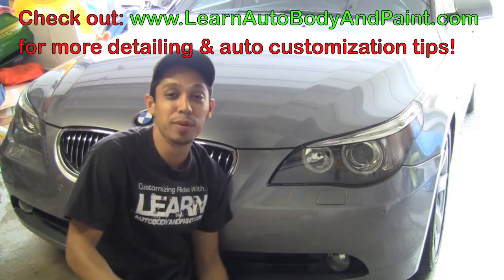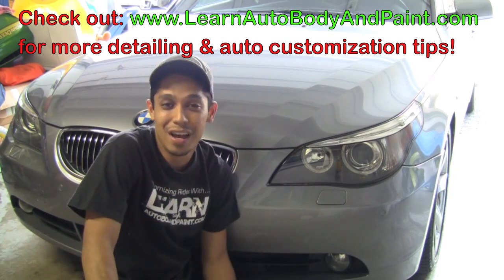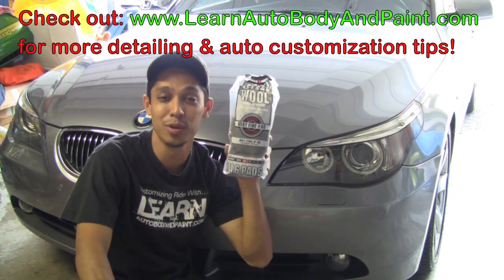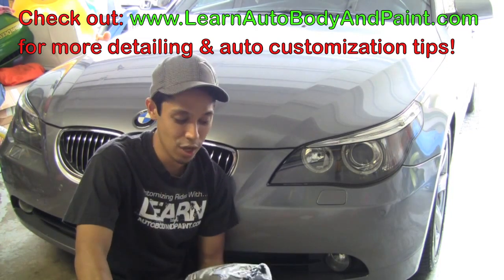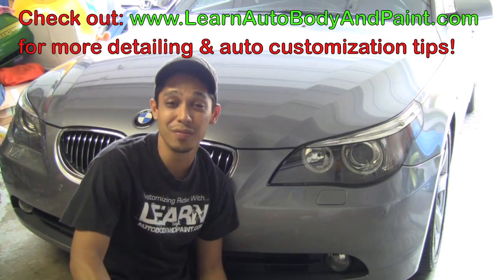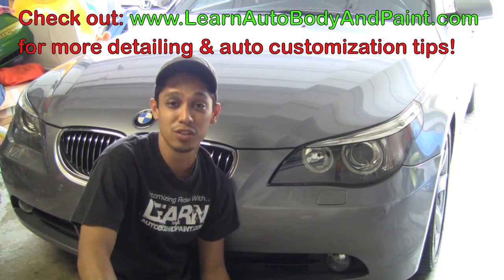Something that's been in my secret arsenal for a long time — I'm just going to reveal it to you guys here — is steel wool. Now some of you may think steel wool will scratch your finishes, but that's absolutely wrong, because double O and triple O, even four times O, is very, very good for taking out water spots on the chrome and all that other stuff.